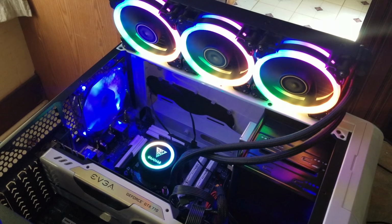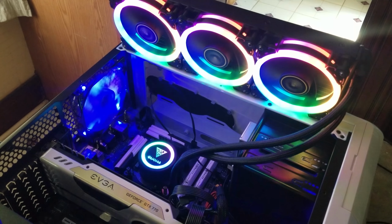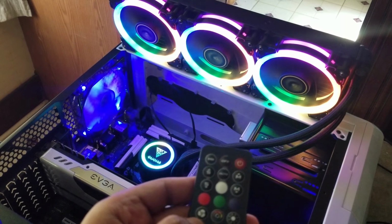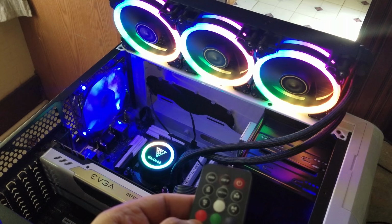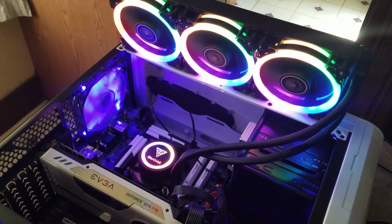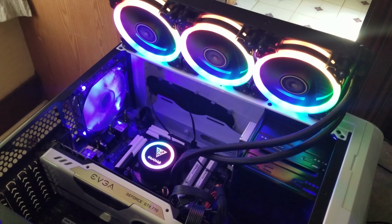As you can see, the test bench consists of a GTX 770, 2GB model. The CPU inside is a 4690K i5, overclocked at 4.2 GHz on all cores at 1.2 volts. I figured this would get me the best results as far as gaming and overclocking in gaming, as far as anyone who would care, because an i5 performs just about as well as an i7 4790K in this generation of Intel CPUs, and it's all I had at my disposal.